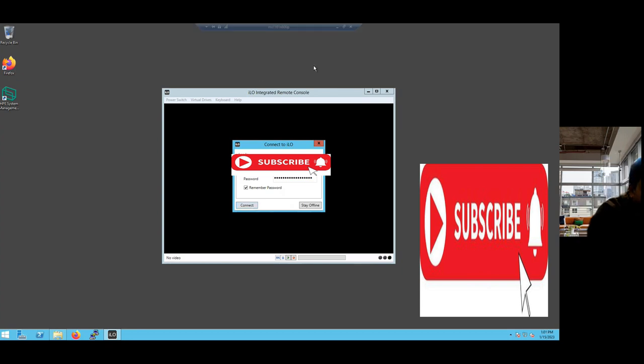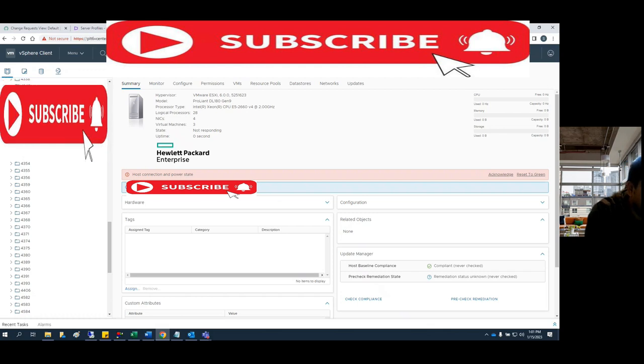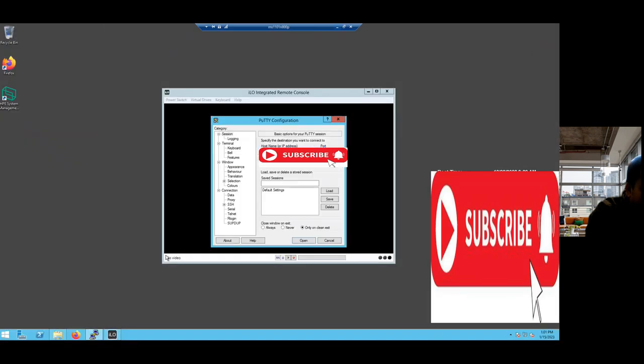After it's done, I'm going to reboot it. After it's rebooted, it's going to reload the ESXi. Then it's going to come back online again. Make sure that, if it's online, by default the machine will be powered on automatically. So you have to power it up again, and you have to make sure it's in maintenance mode. If it is in maintenance mode, after that you have to log into the PuTTY session.